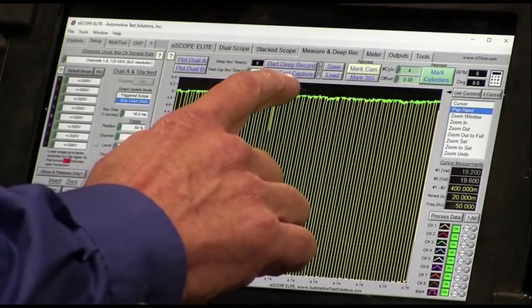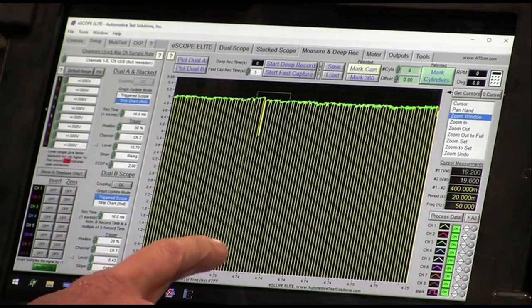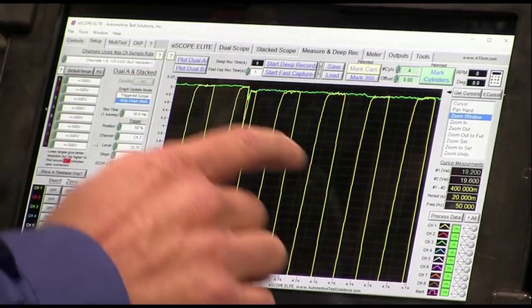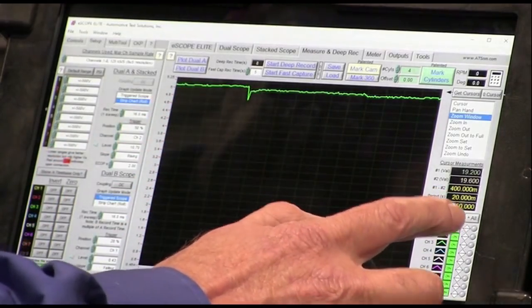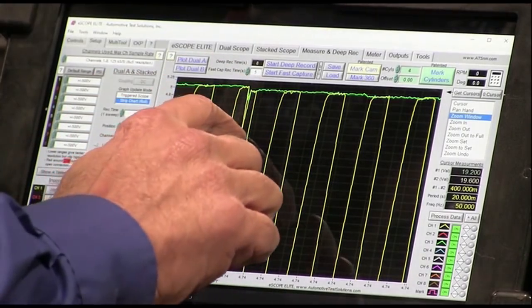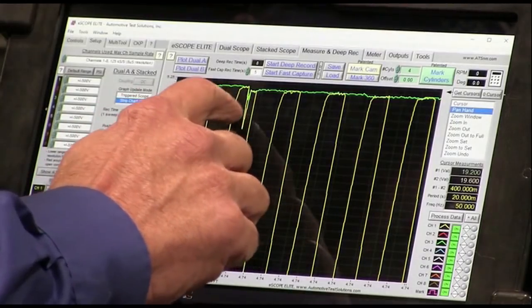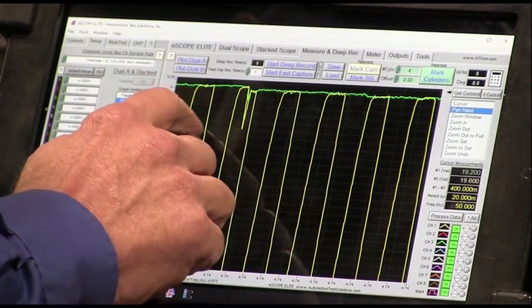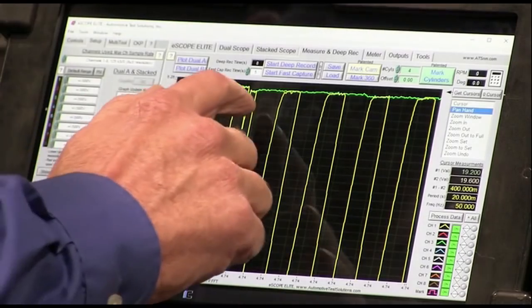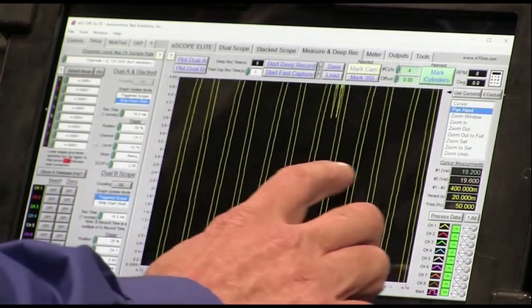Look at that strike right there. Once again, that's in the sensor signal. You can see it, and it looks like it's also in the 5 volts. So I see that in the 5 volts and the sensor, and that's a pretty big drop, guys. The computer could maybe even count something that far down. The further down these go, the more the computer has a capability of maybe catching that, and it gets confused. So there's something going on there for sure.